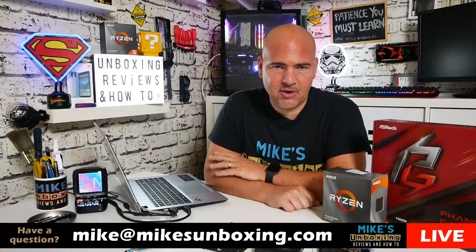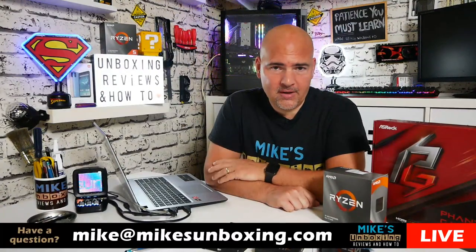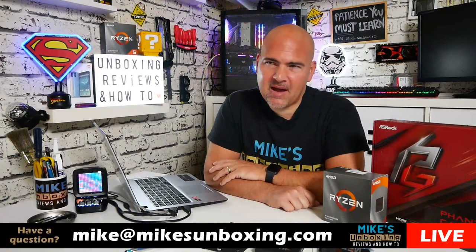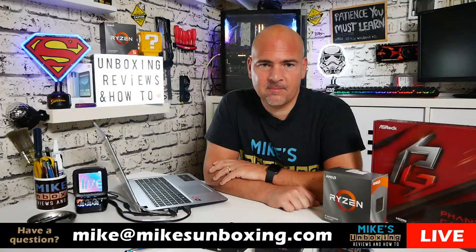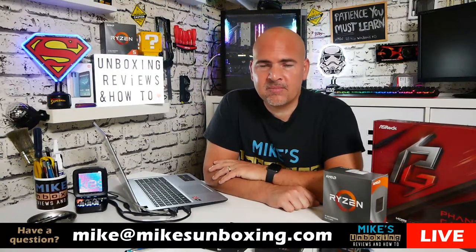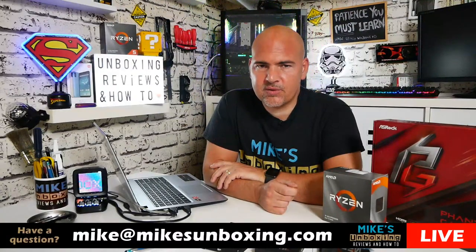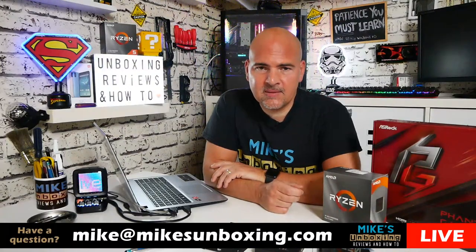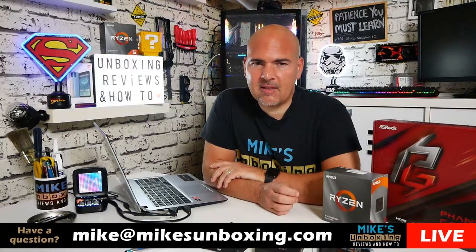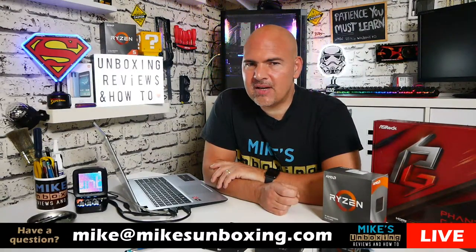Probably less so. The MSI ones generally tend to be the more favorable boards VRM-wise, and spec-wise, again, that's difficult. I suppose the AC Carbon from MSI is probably the best B450 board that I can personally think of. That is at the moment around £130-140 if you get the max version, which is compatible with the newer chips. £140 in the B550 range is in a reasonably good position.